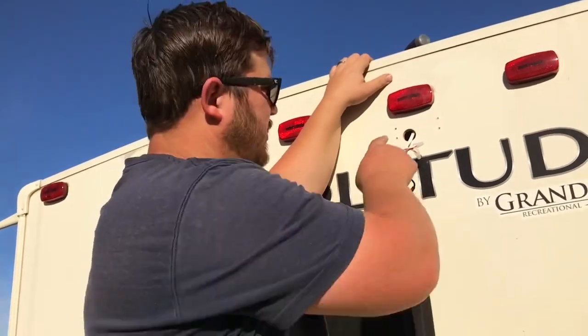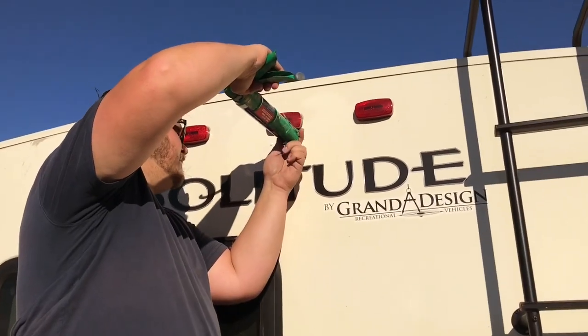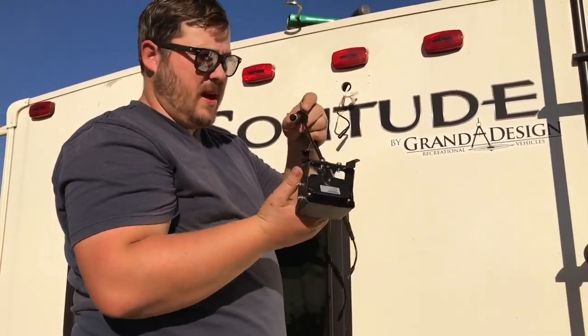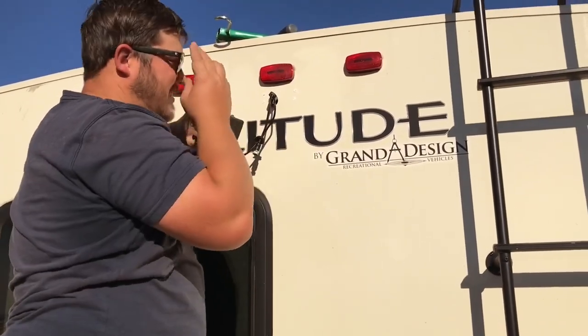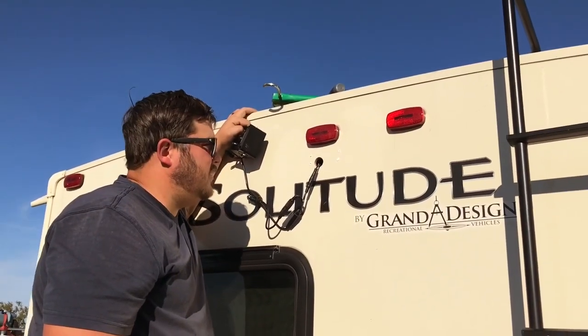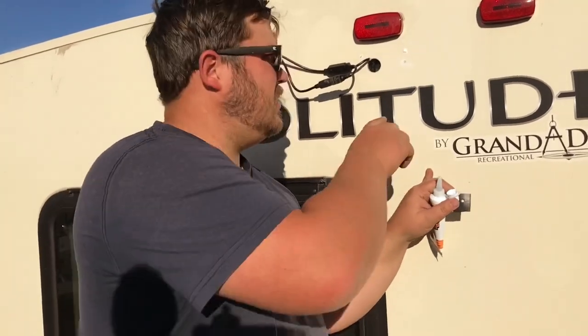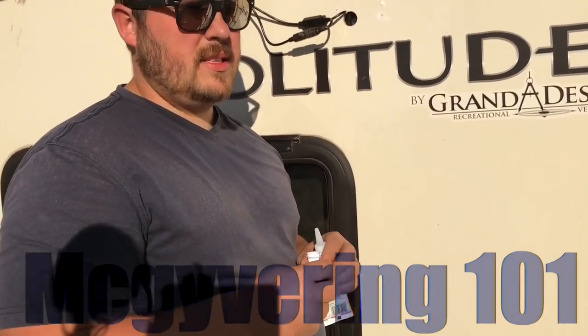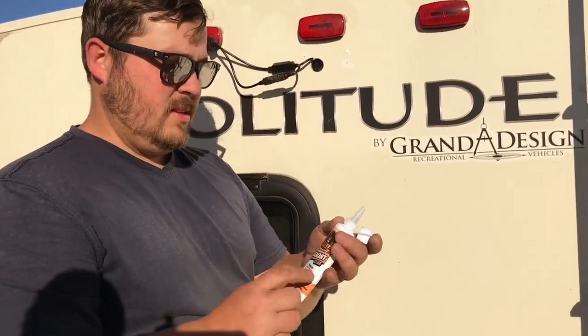Now that you have your camera assembled and you know what parts go where, let's go ahead and attach this bracket to our camera and then we'll go up and attach this up on the trailer. I'm going to put caulking in these four holes so that when I screw the screw in it'll seal it. You won't need a ton of caulking, just a little bit in there. Let's go ahead and reconnect the power to the camera. We had to make a slight modification — the grommet that was supposed to seal the hole is not big enough. I went and cut a piece of the seal from the Furion system, got it to the right size, and we will seal it in with the sealant.